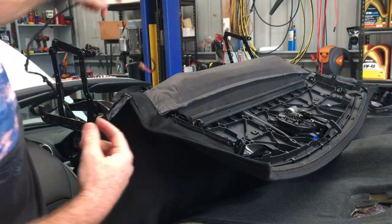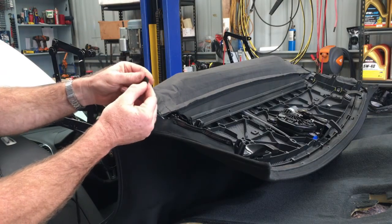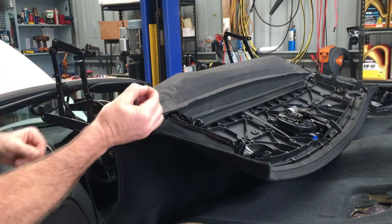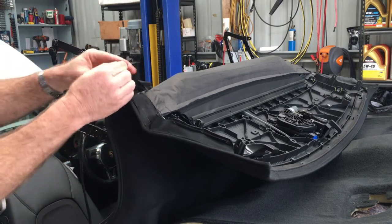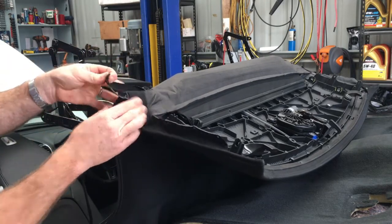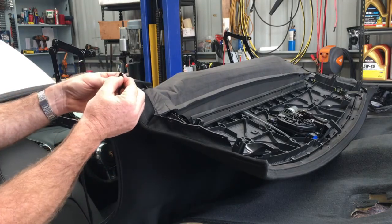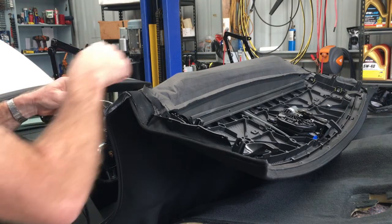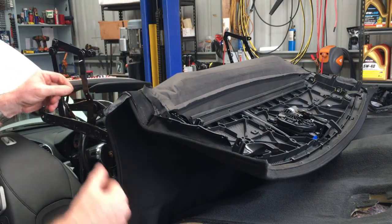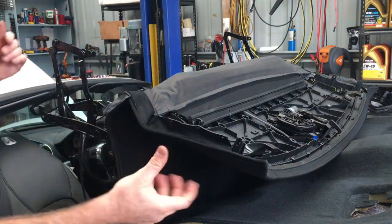Disconnect the plugs, obviously. You also need to drill out the 2 rivets, or a rivet for this one here, which is the bottom one there, and that actually does that big tuck in as it folds back down in that bottom corner. There's that on each side. In addition to that, you'll have the rivet at the top for that pleat cable, which is obviously the one we were trying to fix. So you'll need to drill those out. So this is all loose like this.